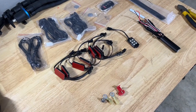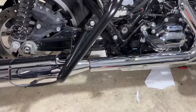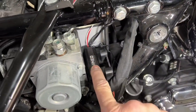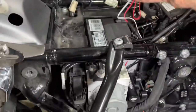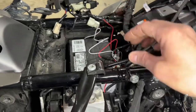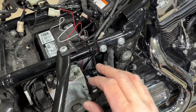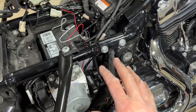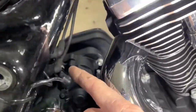Let me show you quickly how I ran all the wires — this is just a test run for now. I mounted the control module right here with the 3M tape inside this little pocket, then I have my wires coming behind there that I'll tie into the battery and into my brake light wire. Keep in mind there are three different cable lengths: short, medium, and long — you'll have to play around to see which ones work best. The first lead off the module I ran to this light right here.